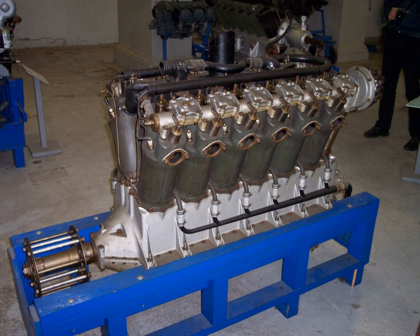It was used in early cruiser tanks, the Crusader, the Cavalier, and finally Centaur tanks. It was a 27L engine with an output of 340 hp, which was inadequate for the increasing vehicle weights as the war progressed and also suffered numerous problems with cooling and reliability. The Nuffield Liberty ran through multiple versions. Mark I used U.S.-built engines modified in Britain. Modifications incorporated new carburettors and a new induction system from Solex, revision of the crankcase breather, new timing gear, and revised crankshaft end thrust, producing 340 hp when governed to 1,500 revolutions per minute.